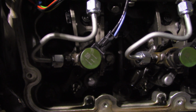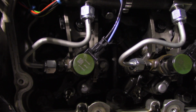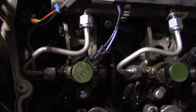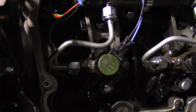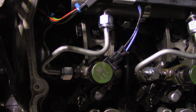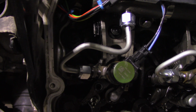I'm not going to give you guys my torque wrench setting, which was 95 inch-pounds, because when you add any kind of length to a torque wrench, you're changing the effective torque at the bolt or the nut. There's a formula, which if I remember, I'll link in the description below. You measure the length of the torque wrench from the center of the handle to the center of the ratcheting part. And then you measure the crow's foot from the center of the ratcheting part to the center of where the nut or bolt goes.